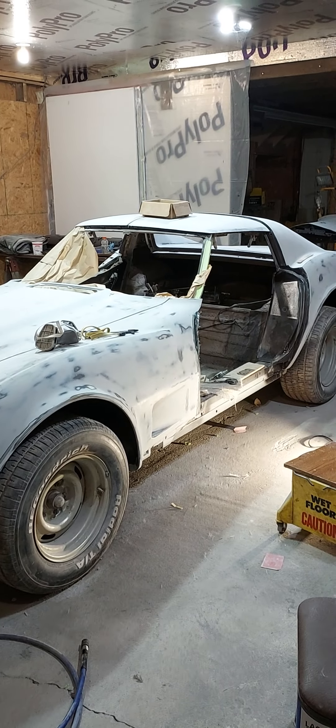I had the same problem on the driver's side, but it was only a quarter inch off, so I made only one cut on that side. I determined that the problem was not the hood but the front clip, and I'm positive that the front clip was a replacement, because I found several issues with it.